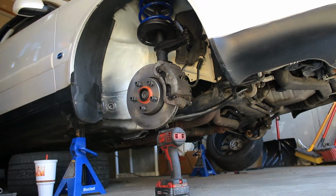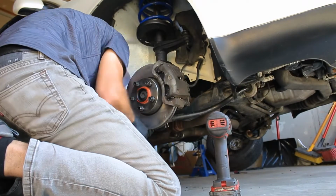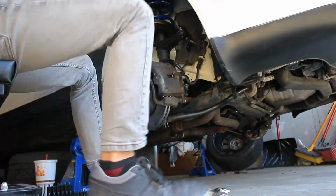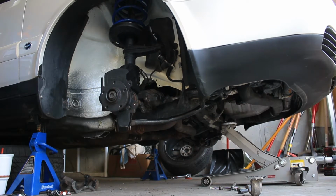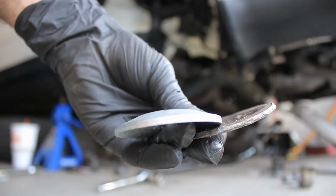It definitely rides very low on the shocks because of that. So, we're going to correct that. We're going to flip those back around to their proper orientation, flip the control arms back around, and I got some new hardware. Pretty gnarly difference.